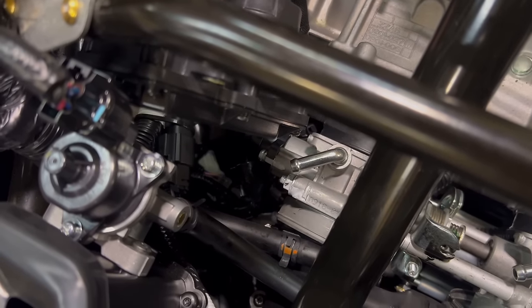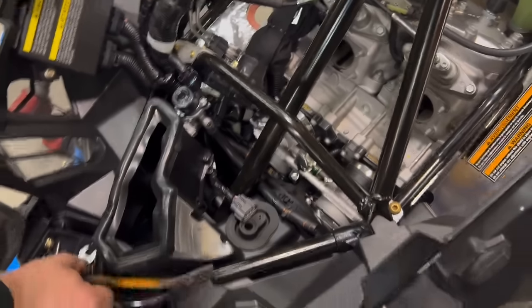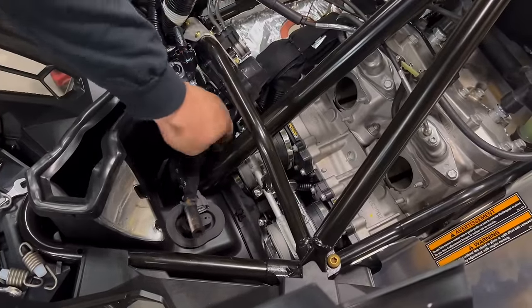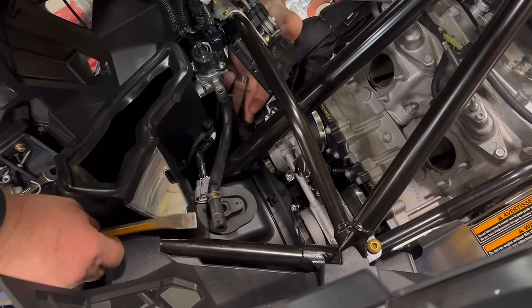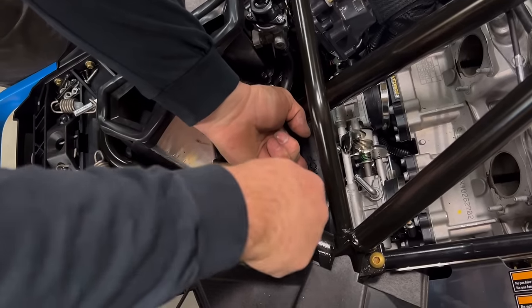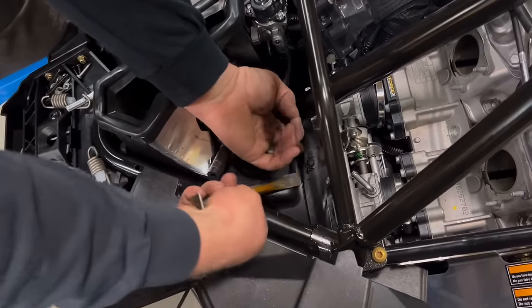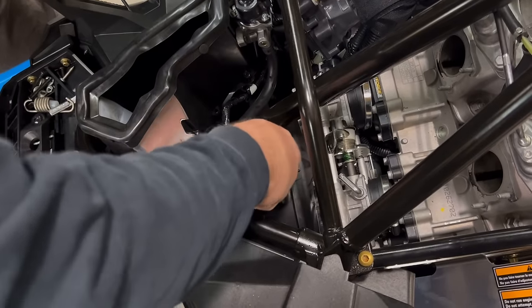and you have part of it out of the way, now find your little bar. You want to pull these idle air tubes out of the way as best as possible. I want to get underneath this rubber here. It is very lightly glued, so you have to work your way around it to release it.